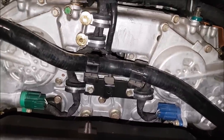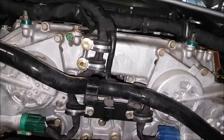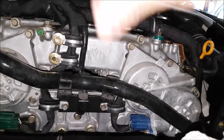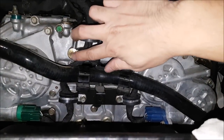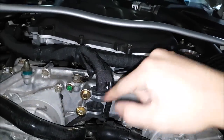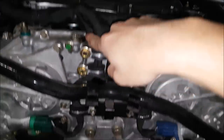If you guys do it this way you don't have to cut anything, because if you have to cut and solder or use butt connectors with glue inside that might be better under the hood. But I'd rather not disconnect or cut any wires in an area like this — there's lots of vibration, lots of heat. I would rather just keep it all factory and make it more durable. I have new bolts here and I made them match. This is where the factory ground was — I relocated the factory ground up to here. It's all one piece of aluminum, so I see no reason why it can't go from here to here. We've re-twisted it so it's flowing nicely with no sharp bends, so this wire doesn't want to break off over time.